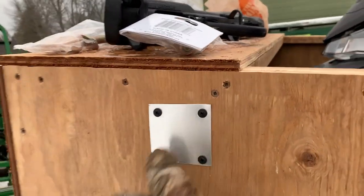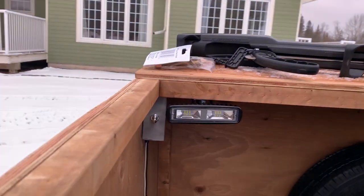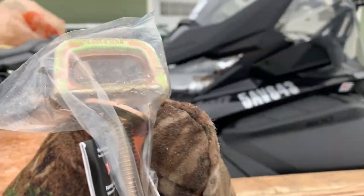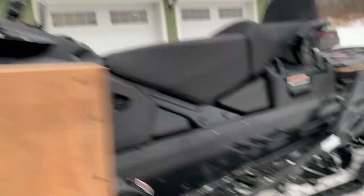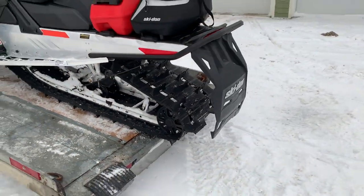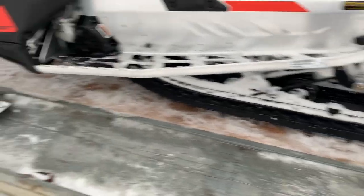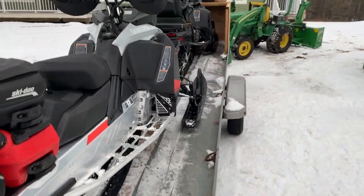There they are - a pair of them on the new setup. We filled in that hole from the old button and we got a new button mounted in there, out of the weather. Now we have to mount two more of these guys for the super clamp - get down in there, find a crossmember that'll work, and mount that up. You could squeak a little bit further but it's not too bad off the back of the trailer - we can go down the highway like that. I'll just get some tie-downs along the side, three down each side, that are in crossmembers.